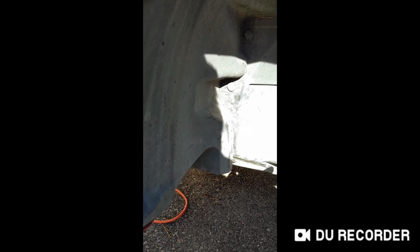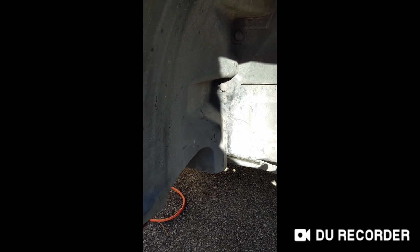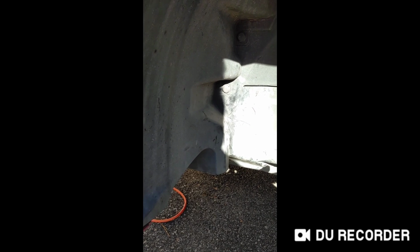Also, if you're using a screw that goes into plastic, I recommend that when you go to reinsert it, run it in the reverse direction a few times until you hear it click, which means the threads on the screw have aligned with the original threads in the plastic piece you're screwing into. That way you don't strip it out when you put the screw back in. It doesn't try to cut new threads in and tear up the hole and give you less holding force.